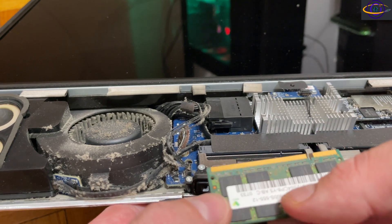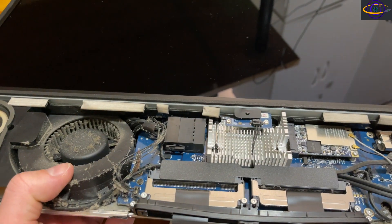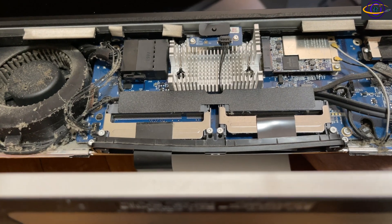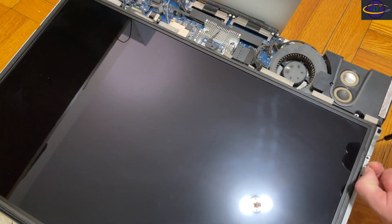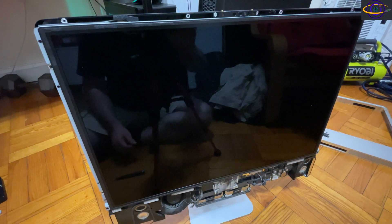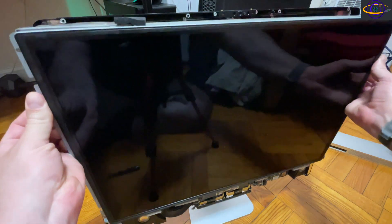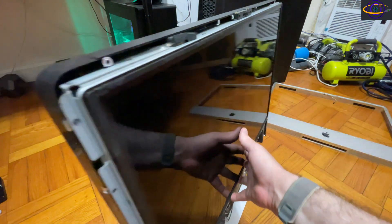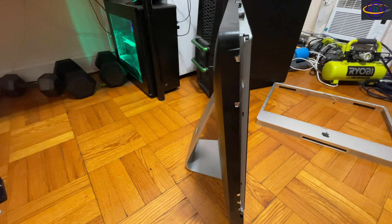You can see there are two RAM slots — one on the left and one on the right. In the next scene I'm unscrewing everything around the actual screen, sped up. Now with it stood on its side, I'll show you a side view — you can only pull the screen out so far because of cables in the way, so I'll show you what to watch out for.